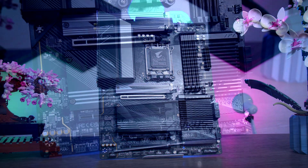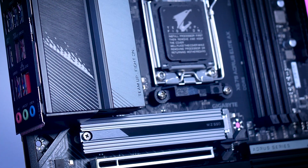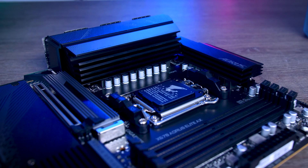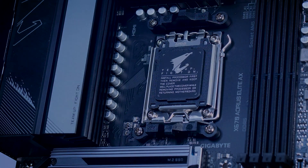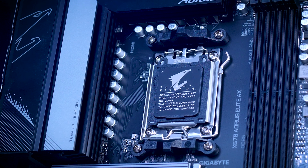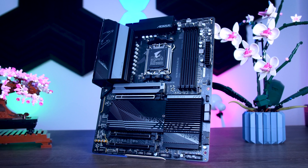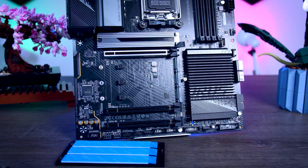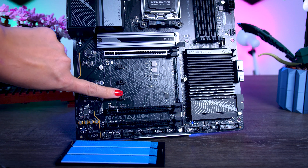Visually, it is a pretty decent board. It has a standard ATX size, you get a lot of big metal covers, and the gray color scheme would fit really well with most other hardware. Power delivery comes through 16 70-amp power stages, which is actually enough to run a Ryzen 9 7950X with a light overclock, but this board will more likely be paired with a Ryzen 5 or Ryzen 7. In terms of connections, it includes four M.2 slots, with one of them being PCIe Gen 5, and all of the M.2 slots have convenient little clips instead of screws, making SSD installation much easier.